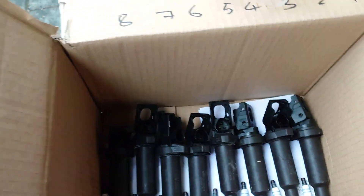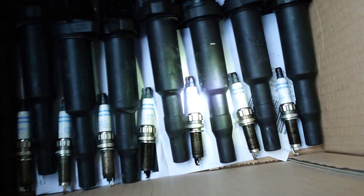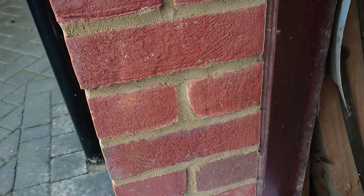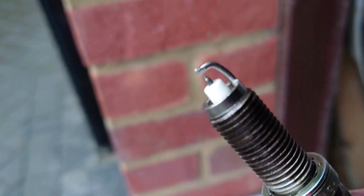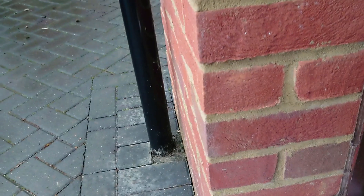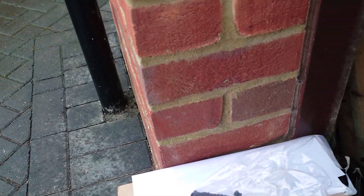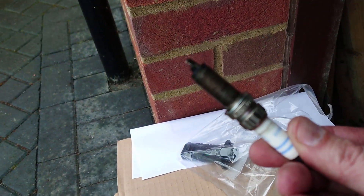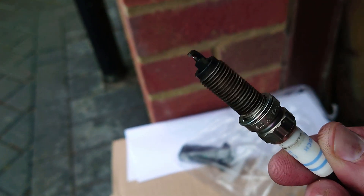So we've got eight plugs. Looking at plug one — it looks clean, slight signs maybe, but I don't even need to know if that's been firing. Plug two has probably been a tiny bit of oil on it, but again it looks pretty clean. Plug three looks pretty dirty, which to me — well, plug three looks like something's failing. I don't know if it's the injectors that are leaking by.